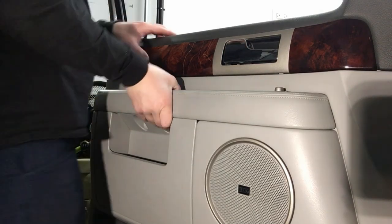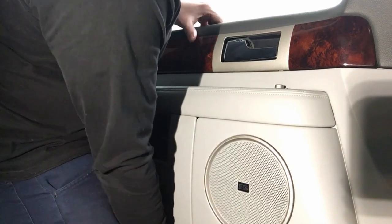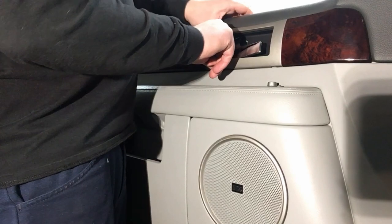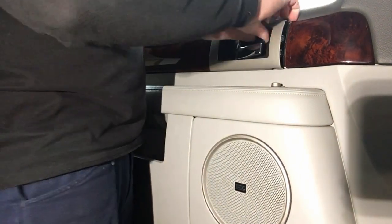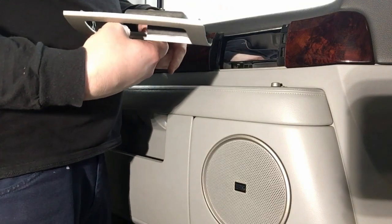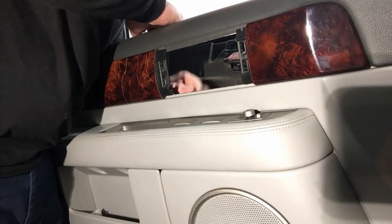So you can pull it off to the side here. The top part pops out, usually locks in up there, but the rest of it simply slides up. Now this right here, you should pull off too. Technically, this trim panel right here, be extra careful with it. Almost get it out by hand here. Just one of the alignment nubs on there, no big deal. Get that off and then we'll be free. And then you just reach around the back side here and start pulling off connectors.